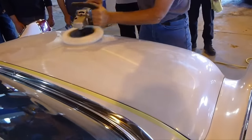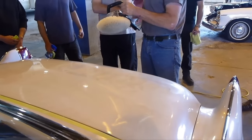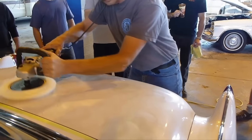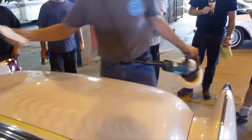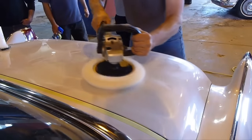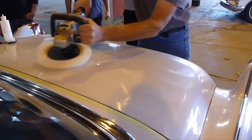Running at low speed and with light pressure — just a light pressure. What kind of compound? This is actually a Meguiar's 105 — it's considered very aggressive. You need to pay attention because this is a fresh buff. You can see I've got dry spots already.